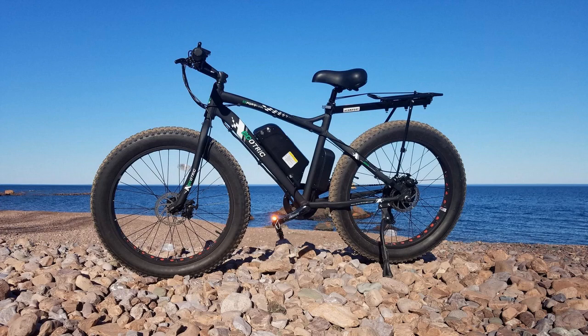It uses a Shimano drivetrain, nothing fancy, but not bad. At least it is a name brand Shimano one. I mean, it's a lot better than a cheap knockoff one. So it is a legit Shimano system. Mechanical disc brakes, which stop exceptionally fast, very, very well. And they do have cutoffs on them, which is really nice. I didn't think they would initially have that for a bike of this price. What that means is when you pull the brake, it disengages the motor. So you're not fighting the motor if you accidentally forget to lay off the throttle. When you brake, it's not going to fight the motor to stop the thing, so you can stop a lot quicker, which is important because these bikes can go really fast.